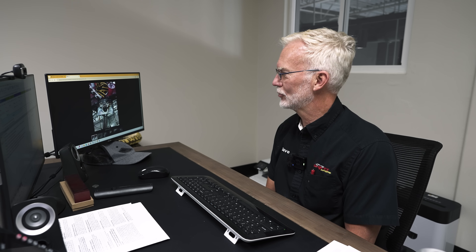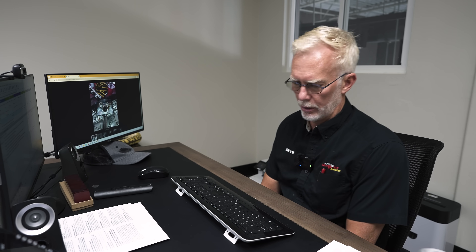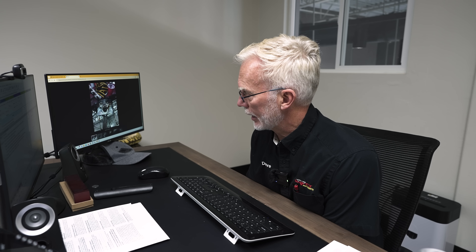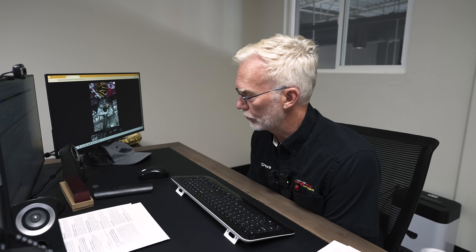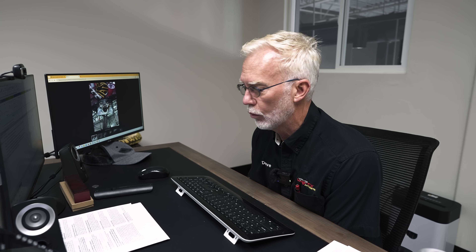I'm a great mechanic, but I have to holler at my 24-year-old kid when I need the computer screen to come on. This is not uncommon, and it usually happens - I've seen it on European cars. It's more prone on European cars, I think because they're turbocharged and they like to go fast. What's happened here is the oil and the fuel are combining between the second and the top ring. The compression ring is the one buried at the top. The oil is getting in there - you can see the carbon between those two rings. The oil gets by the oil ring, gets by the oil scraper or control ring, and it sits there.